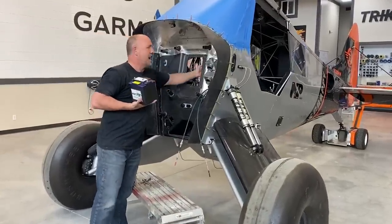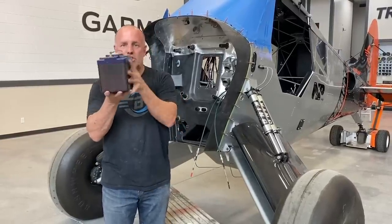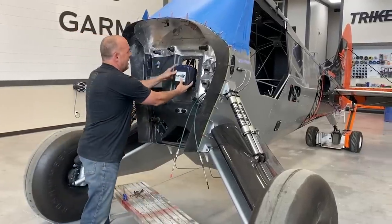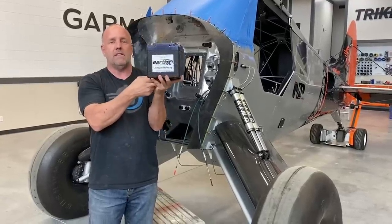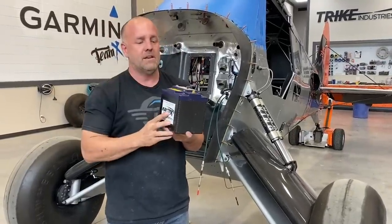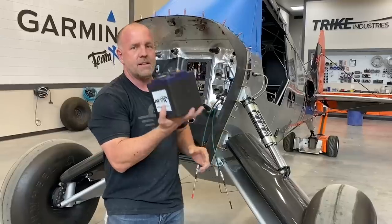What's great is I already had a flat plate right here that I want removable so that I can access and get behind here if I ever need to. I'm going to take that flat plate and make a box so the aluminum tray that holds this can go about halfway into it. That way the weight of the battery is inside halfway, and when I go over bumps out in the backcountry, I'm not trying to bend a bracket off the firewall. The weight is centered, going straight down. I'll leave the wires just out enough to carry out easily.